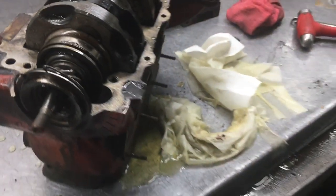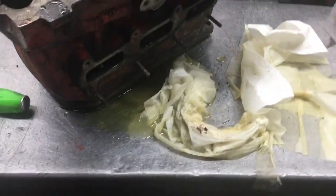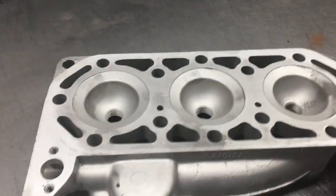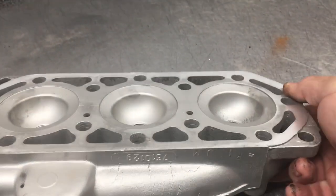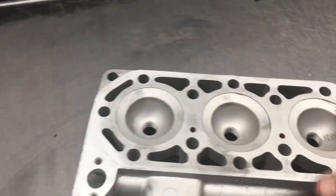What happened — it overheated in traffic or had a radiator hose issue, I'm not sure what. But all that water you see there, that all came out of there. The block was already drained and the head I've already sanded. It's kind of hard to tell, but you can see right here and right here are your high spots.